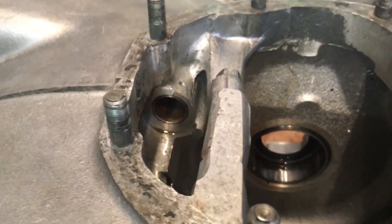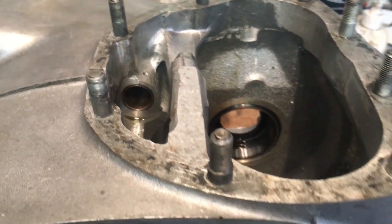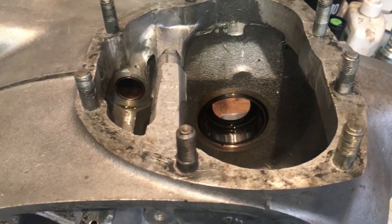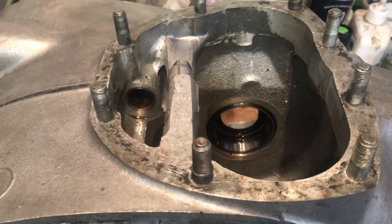It's not going to take much to do this but we just needed the right tools to ensure this was lined up, because as you recollect the issue we're having is that when the cases are bolted up with a cam in, the cam is excessively tight and very difficult to turn, so we wanted to clean that bush out.